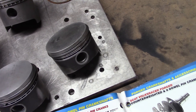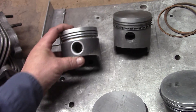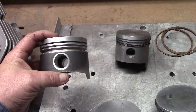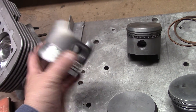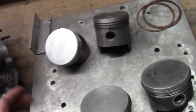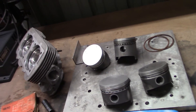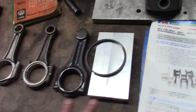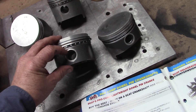I don't like to do it that way — it makes the ring sort of weak. This is a piston I had made and it's in between stock and the factory location. This is for a Baja car — a cheater piston. That's one Baja 1000 race on it, beat up. It was an 87mm — a half 87, half 1600 cheater motor. Getting back on compression height: when they say compression height, that's where the pin is located in the piston, and that determines where the piston is going to land at the top of the cylinder.